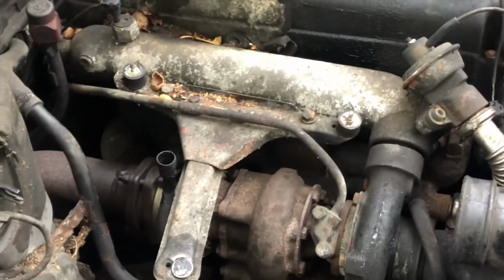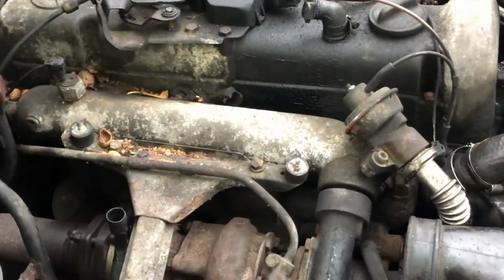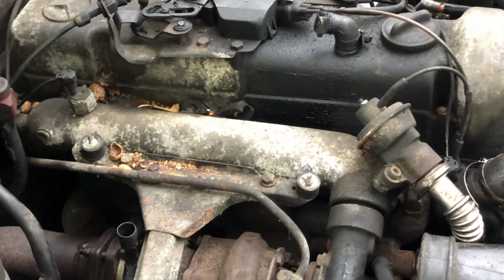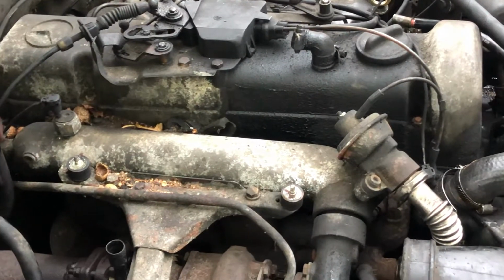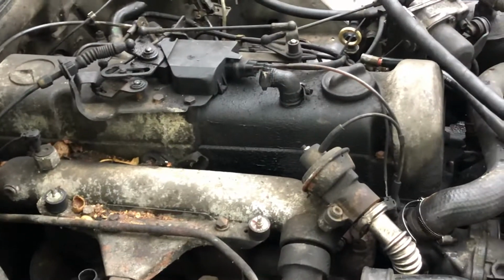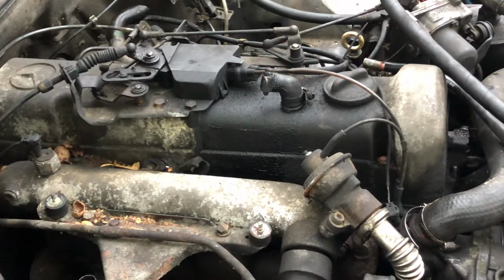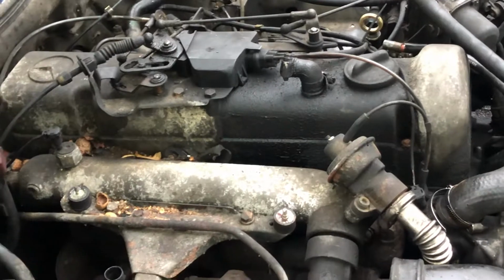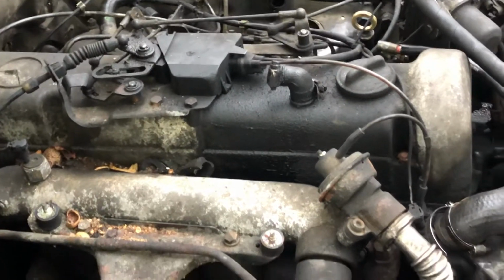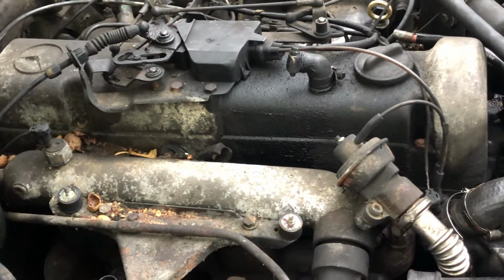I like the diesel Mercedes engines. They're way cheaper than the Cummins 4BT, and I have never owned a 4BT, but I've been around them some, and I have owned several 6BTs or 5.9s, whatever you want to call them, and I don't believe that the Cummins 5.9 is any better than these engines. I believe they're just as good. They're much more powerful, but I can buy 3 or 4 of these for what one of those Cummins 5.9s costs, and they're about twice as heavy and quite a bit larger in size. So this is a good alternative if you want to build a little driver. It just depends on how much money you want to put into it.